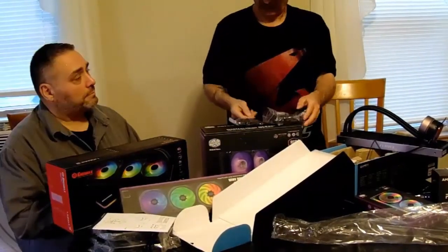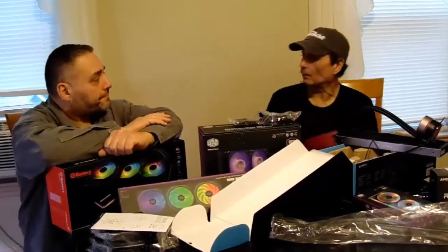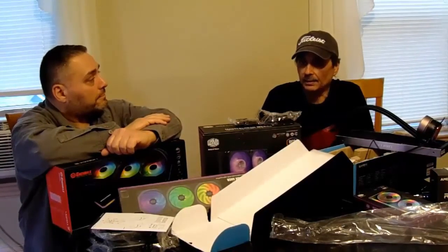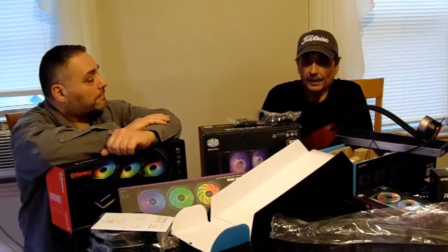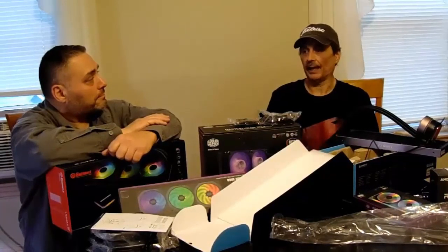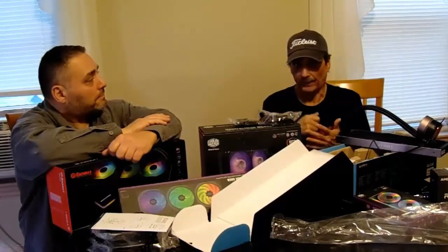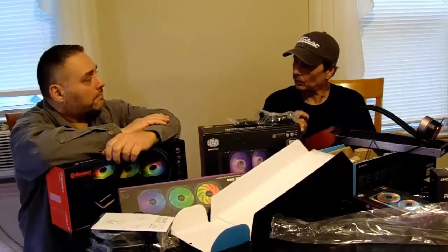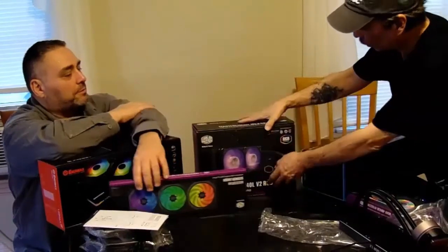I have a hub. I have a couple hubs actually. One of them is the one I did a video on with the Asus, and that one is just ARGB. And it's nice, it's easy. I have a Cooler Master hub with power and ARGB on it, and you have to get the Cooler Master ARGB cables to fit on it. It won't take a generic for some reason. They just run a little bit too big, and unless you want to shave some off, it's not going to work.